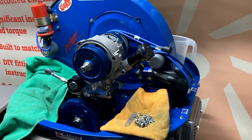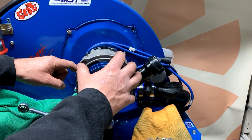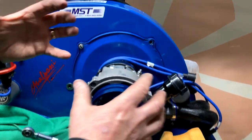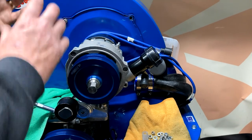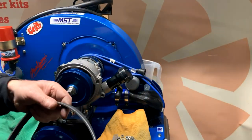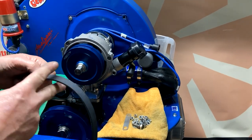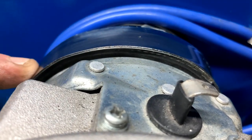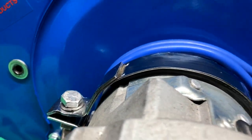Just while we're talking alternators - some alternators on the original stands with the clamps can be quite loose. Your alternator is going to get a bit of stress on it because it's going to be pulling up onto the supercharger. What I've done is taken a piece of an old belt, about 100mm in length, and fitted it underneath the alternator strap. That just helps stop the alternator from moving and stressing. Just a little tip there.